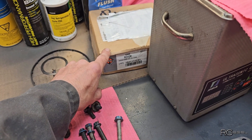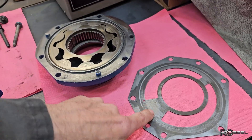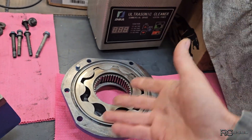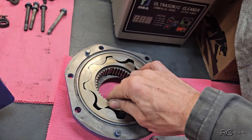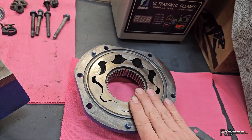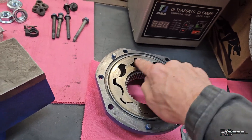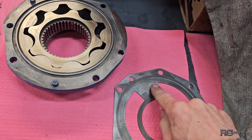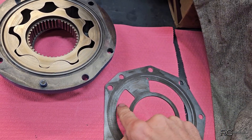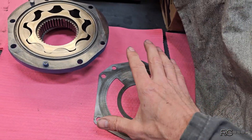On an expensive brand new engine rebuild you don't want to put a used oil pump on anyway. So I ordered an oil pump rebuild kit, and according to International I got the last one in North America. I don't understand how an engine that's only 20 years old you can't buy parts like oil pumps anymore. I got my gears but they don't come with the wear plate. When this pump pumps oil, it gets pulled in on one side of the rotor and as it spins it pushes out the other side, and the only seal between the high and low pressure side is this wear plate sitting on top.